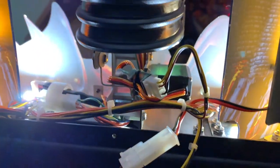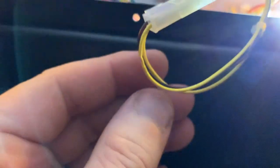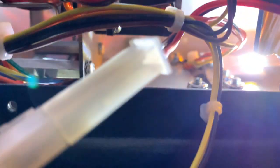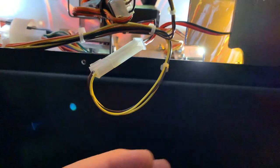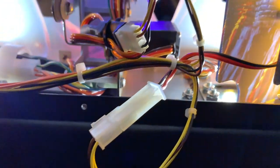one, nobody checked it before it left or they would have seen that. Can we get down in there enough to see it? See that screw right back there, straight back? This little yellow wire, as you can see, was pinched in that bracket for the screw, causing it not to work. Luckily, once I freed it and bent the wire a little bit and re-plugged it back in, we're working. But I was about to be very disappointed there. Slight detour, nothing big, nothing we couldn't fix. So now we gotta button this back up on the back.